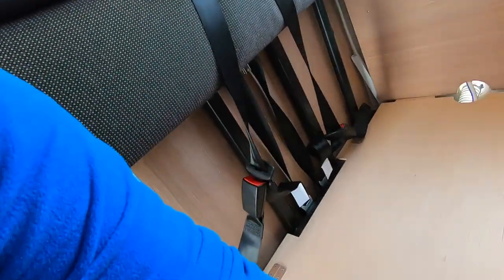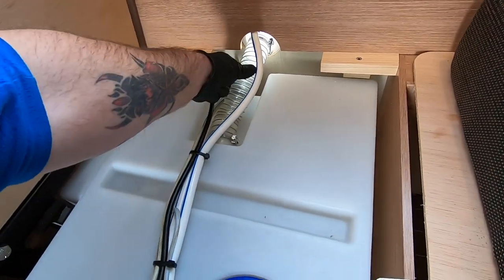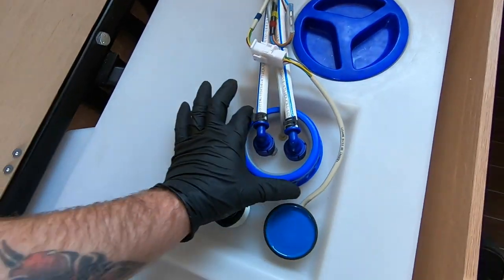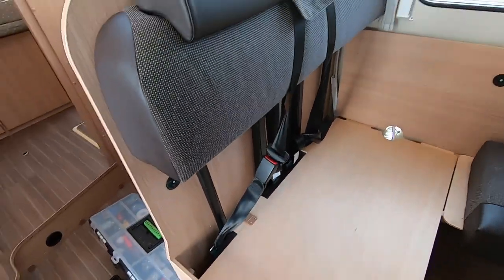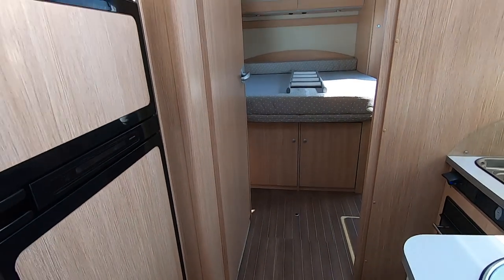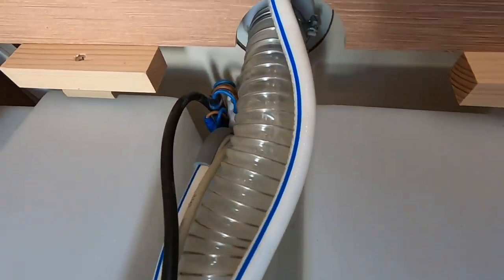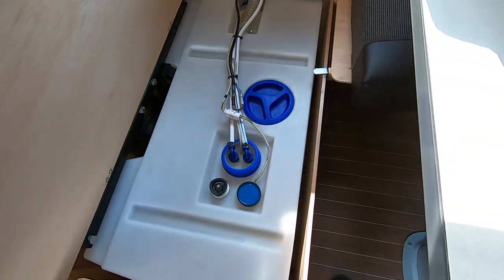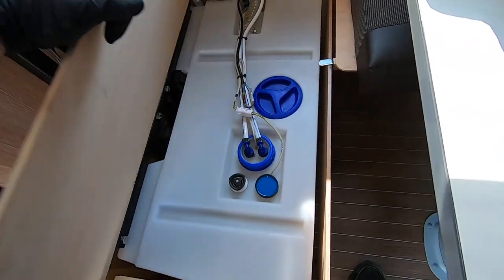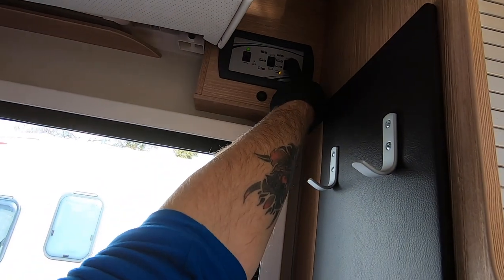Gas has pulled through now, so I should be able to check all of the gas appliances. Before I do that, I'm going to top the water tank all the way up, and check that we've got no leaks from the inlet or any other part of the water tank — get the fresh put in. Then we can also run the water heater on the heating. As you can see, water coming in now, no leaks, which is all good. We'll brim the tank full just to make sure we've got no leaks on the top of the tank. Also check the water level function while we're there.